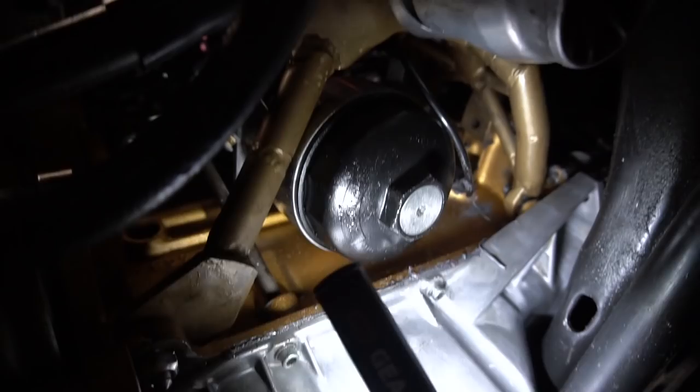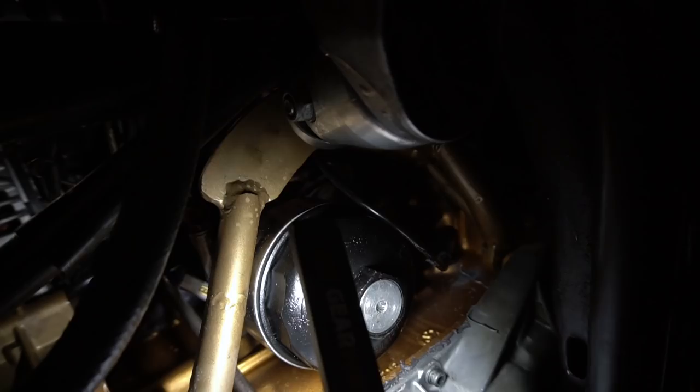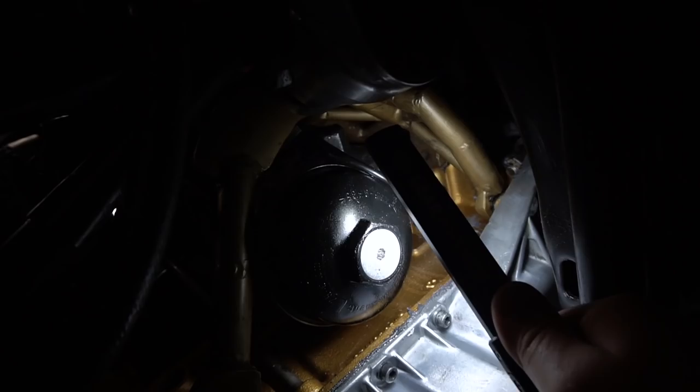But keep in mind, in order to get to the oil cooler, which is up in the corner there, I don't know if you guys can see it, that little wrench part right there, we have to get this thing off. So we're gonna be unscrewing one, two, and then three to try to move this cage out of the way so I can loosen that sandwich plate that has a really large spacer. I don't know if you guys could see it from the bottom, look how much it sticks out. And then we can remove it and then assess how much we have to make new lines for in terms of the lengths and everything. We're removing this to get to that cooler. I should have it off in about 2 seconds.